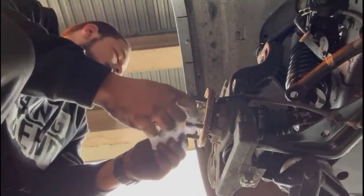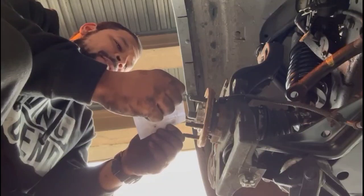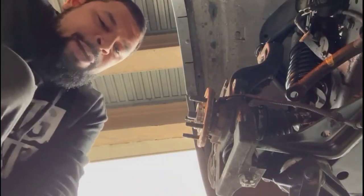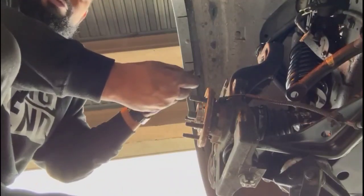Yeah, so I did it off camera, y'all. Sorry, that's the problem with recording sometimes. You just gotta think in the moment, but we're on to the stabilizer link. It says the barrel nut must be installed through the eye of the sway bar. So that's at the top, and then you have the nut on the bottom. That was always a question. So the barrel eye, this big one, on the top, and then the nut on the bottom. So let's get it. It's a brand new one.